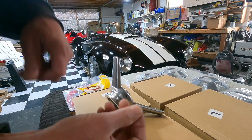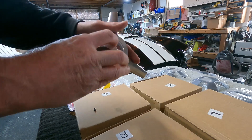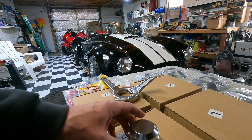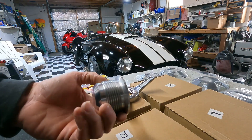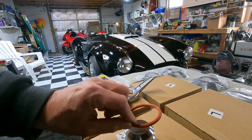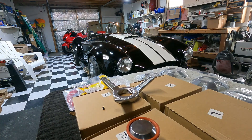These also come with a set screw that has a little Teflon-impregnated piece at the end to lock onto the threads. Some people just get rid of these — I think if you don't tighten down too much it'll be alright. You don't want to bugger up the threads. There are thousands of different opinions: some people say put anti-seize on here, some say no because it collects dirt and makes them difficult to get off. Some people use dry graphite spray or powder, some stick a pool noodle behind these to push them out. I'm going to go the o-ring route — slip the o-ring on and that should hold it out. I'll probably use a dab of anti-seize too.